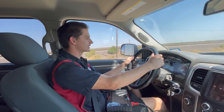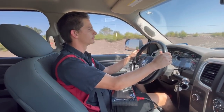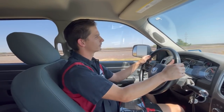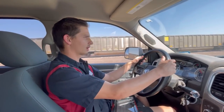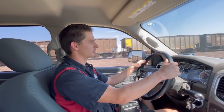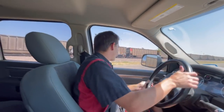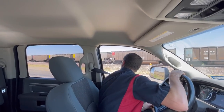Now we're going to go all the way up to sixth gear, still staying at low RPM — nothing crazy. I haven't been above 2,000 RPM one time. We're at 55 miles per hour, transmission at 156. Sixth gear and locked up. We're going to go back to the shop, get a couple miles on it, let it warm up, then check fluid and check for leaks. Double check, triple check all your work — that's how we stay a step above the rest. We don't cut corners.